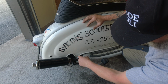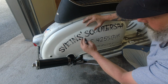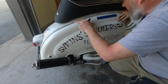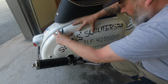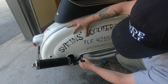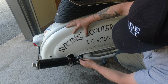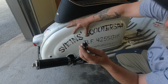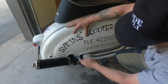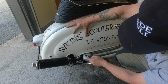Nordspeed exhaust. What I think I'm gonna do is, how much do we have to take off here? The problem being now, I can't really get it to sit as far down as it should be sitting. Because of that, I have to sort of jam it in there. Because of movement from the engine and that, I'm really going to have to sort of take off that much there. This is a white marker pen. It's the only thing I found. Will that be enough for suspension movement? I suspect not. Maybe I should just go all the way there.